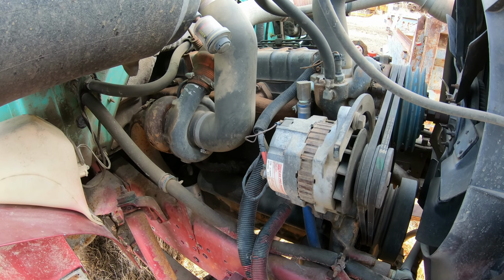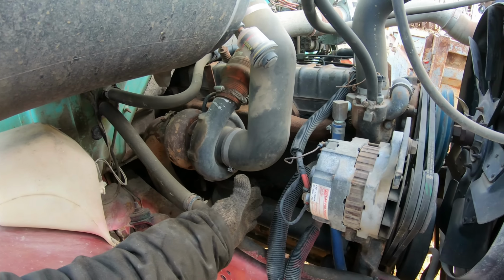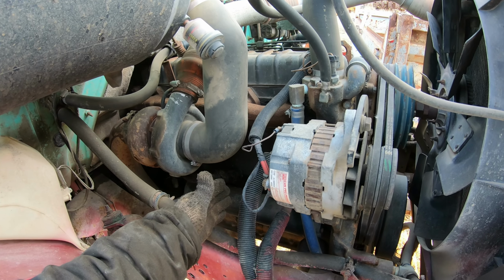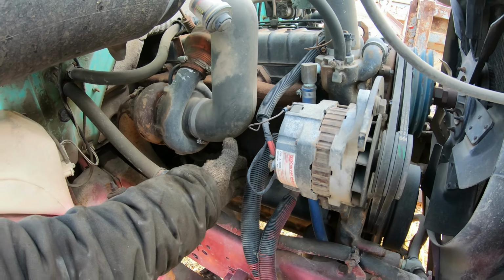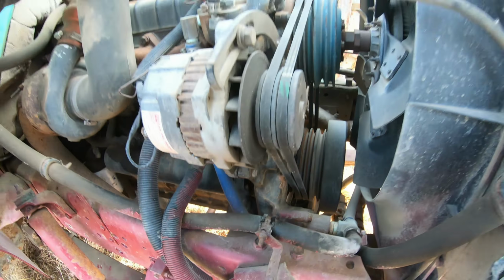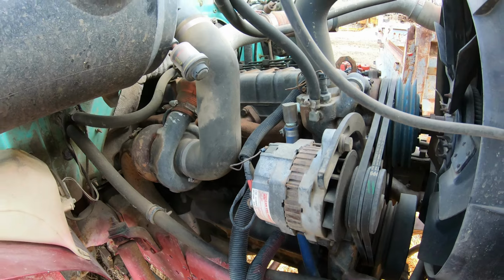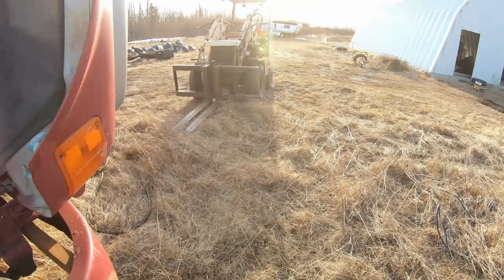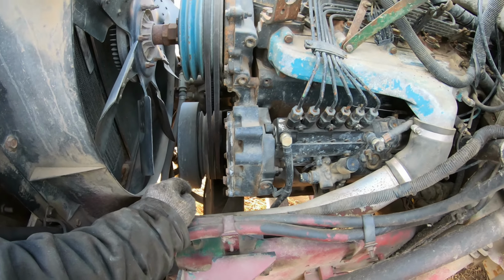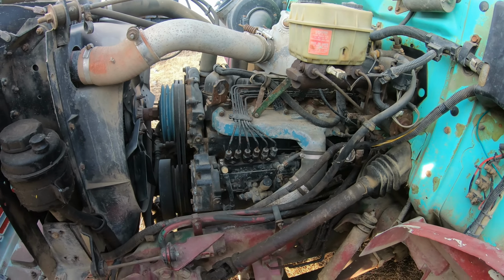Well, that makes it kind of difficult because you're gonna need an engine mount right here on the cross member on the F350. Is there a place for an engine mount there? No, there isn't. There's just an engine mount at the front, engine mount at the back. I might have to rig something up. Just 4 engine mounts, or 4 places the block is bolted in.